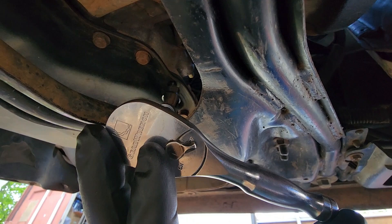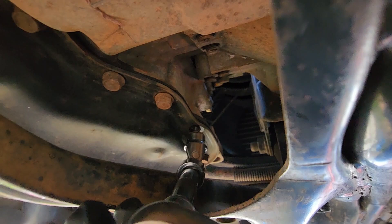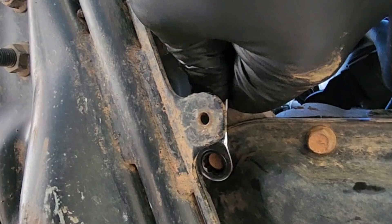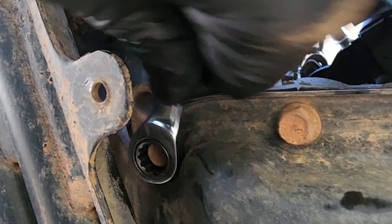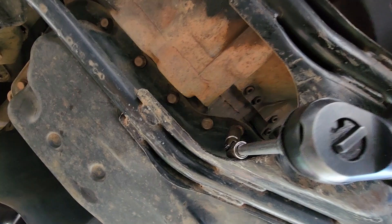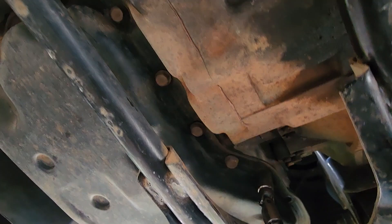What I came up with is a swivel socket with a three inch extension, and a stubby three-eighths ratchet — that seems to be getting that one off. For the other one, looks like a 10 millimeter ratchet wrench will fit on there pretty easily. We can get it at least broken loose and then spin it out the rest of the way with our fingers. For the rest I'm just going to use this universal — it's just a quarter inch anyway.